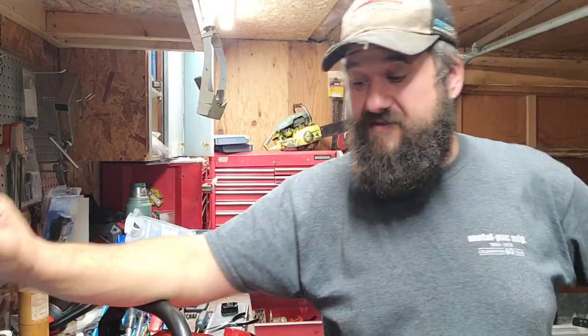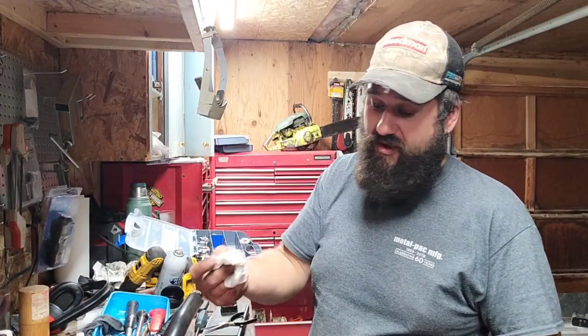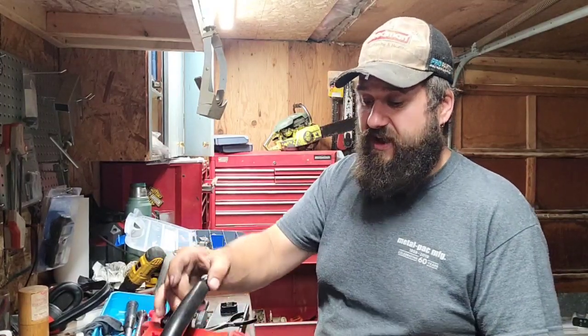Because this is a special saw and we need to give it special attention. We're building it together on the channel and we're going through all the problems. I will run this on film as soon as I feel it's film-worthy. It's not very good right now — it's really hard to start and hard to keep running. Now I fixed the reeds today. It starts easier, runs better, tunes better, and I actually got it to idle today. It would not idle yesterday.